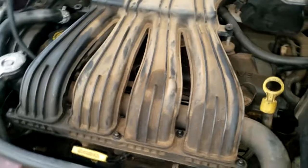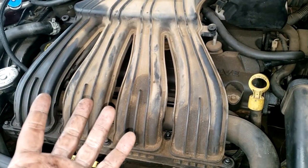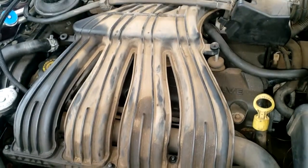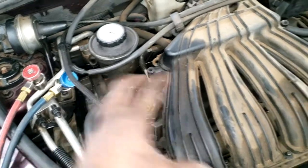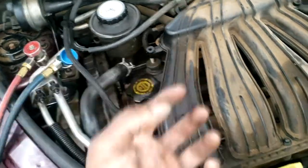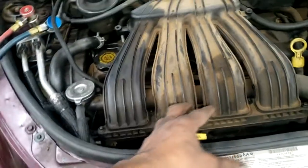That's why if you get a PT Cruiser that's jerking and lurching with the AC on, or even at idle — hard jerk sometimes or vibration sometimes — that is the fan pulling down the whole electrical system. I hate when this happens, especially to me. I would have never found this had I not put the freon back in the car. She's entitled to her freon — we reclaimed it to make the repair.